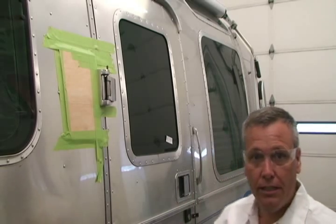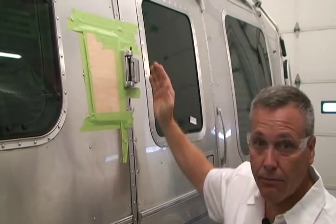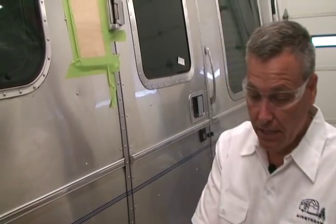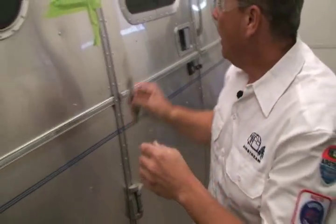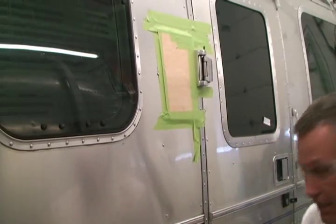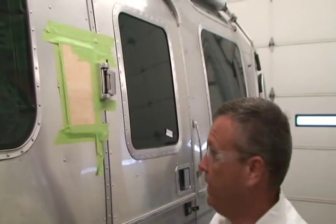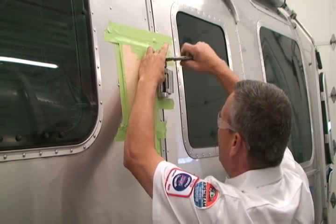I want to decide how the hinge pin is sitting in there. If it works its way up like this one, sometimes I can just pull the hinge pin out from the bottom. Other times, I'll take an eighth-inch pin punch — notice it's not tapered — I'll drill a hole at the bottom and tap the hinge pin out. Let's see if we need that first. I'm going to take some vice grips — we want an old pair, not our good vice grips — and clamp on it.